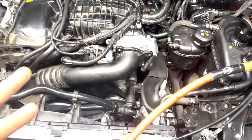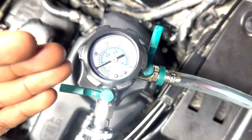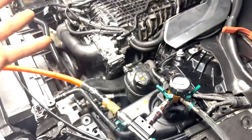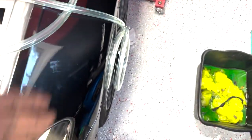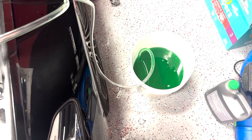In case you're wondering what all the coolant lines look like in here, feel free to feel all the coolant lines. I'm only doing right now the main coolant system, so we'll see how this holds up. Right now it seems like it's holding up really good, and yep, still going on about 2 minutes now. At first I held it at 0.5 bar for 2 minutes, then I held it at 0.95. So after you wait, then you're free to dip this inside of your HT12 coolant. I've got some HT12 coolant spread around the shop. All right, it's literally been holding this vacuum for 15 minutes, so here we go.